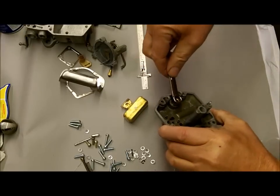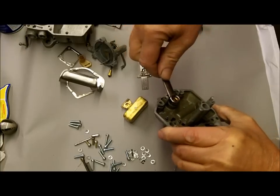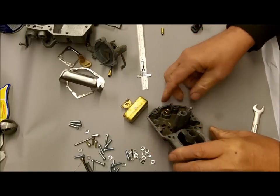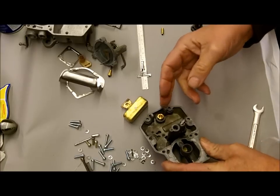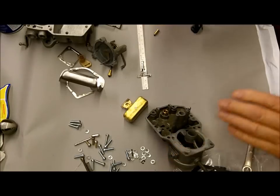Use a 3/8 wrench and move it back and forth a little bit to make sure that gasket is seated well. Incidentally, if you forget the gasket, or the gasket's broken or something like that, you'll get a flooding situation — gas will come in around here instead of through the needle and seat, so it'll never shut off. So if you have a flooding situation, that could be one of the problems.